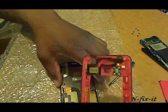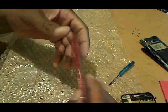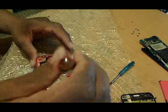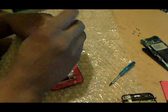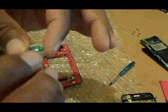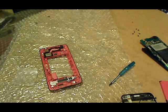Now what we're going to do is show you how to take out the dual LED flash — you can see it right there. You're going to get your Phillips screwdriver and remove the two Phillips screws that you see there. Get your LED flash — something that small — and put that to the side.